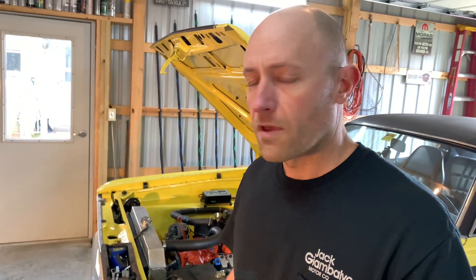I tried to do this video with little to no editing so nobody could say I readjusted something during a pause - which I did not. So that kind of puts it to bed. This isn't the end-all result - this is a pushrod V8 with an iron block and iron head. If you have an aluminum head, from what I read they can expand even more, making the lash even greater. I also read that if you run tight lash hot, you can actually have a no-start condition when the engine is cold, because the lash closes up and holds the valves open - you won't have any compression.